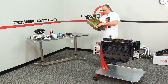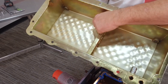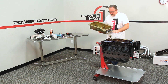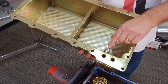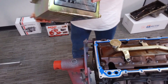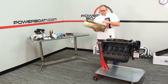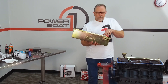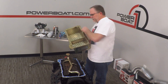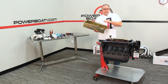This dually pan has a bypass in it that's kind of a factory setup. It's got a trap door inside so the oil stays at the back where it needs to be and then can rush forward to stay at the pickup. It has the oil galleys on it, so this is where we're going to come out and go up to our oil filter on this setup. Before you put a pan on you always want to make sure you clean the inside because you never know what's happened in shipping. With aftermarket pans you may have to open a hole up a little bit because it may not fit perfectly with the block alignment — a couple of them I had to open up to make it easier to get the bolts on.